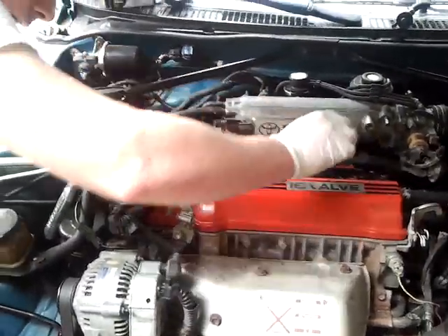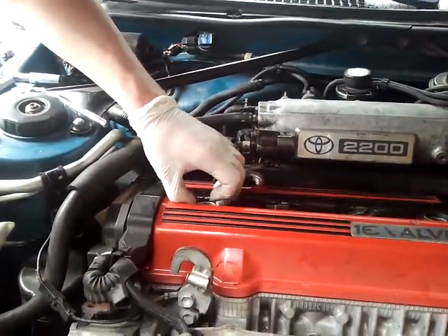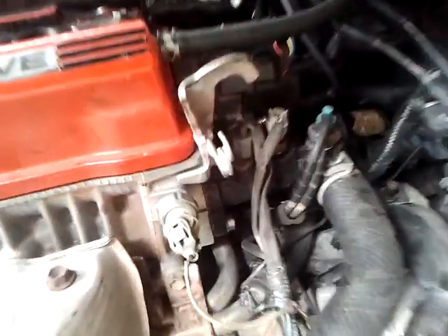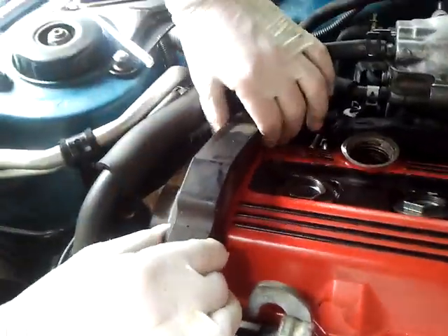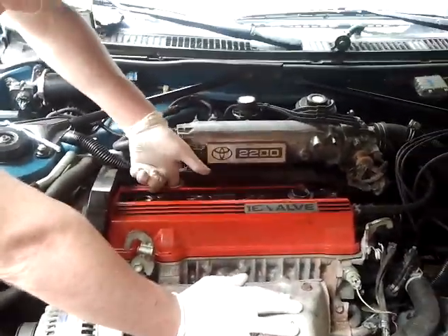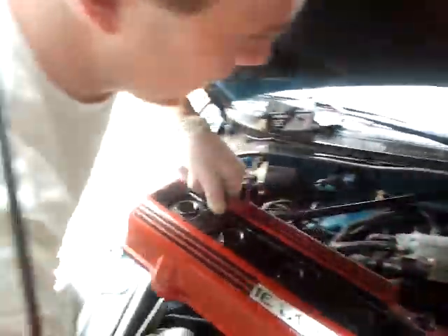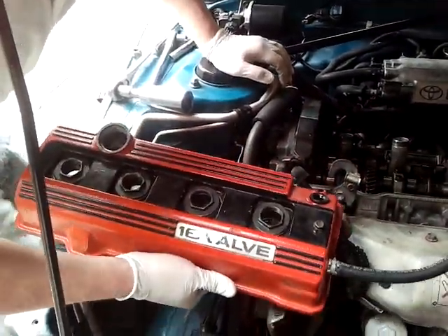Once you unscrew all those, don't bother removing them because they'll stay pretty good in the valve cover. There's a gasket that goes underneath. To break the seal loose, grab the breather hose — there's a nipple under there where it grabs onto the valve cover — and use that to break the seal. This wire conduit right here is going to prevent you from pulling it out, so wiggle that out of the way. The best place to grab is to put your finger inside the oil filler hole, hold over on the other side, and you can lift it right off and wiggle it out. And that's how you get the valve cover off. I'll probably do the rest of the video in pictures because it'll be more time consuming. Thanks for watching — this is Special Eddie.